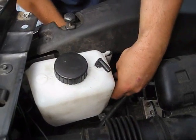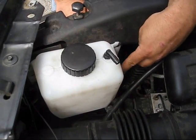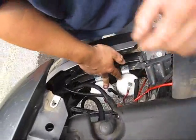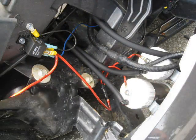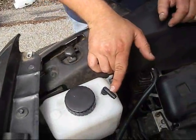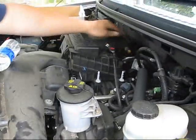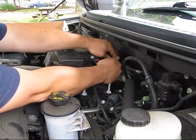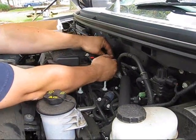You need to cut your hoses to length — the shorter they are, the better. Make sure there are no kinks in them. The hoses on the side of the tank go into the top of the units, and the fittings on the bottom of this tank will go into the bottom of these. The only connection you have to make to the engine is from this fitting here up to the intake tube. Ford's made this one easy — they've already got a port on here — but most of the time you'll have to drill a hole and put the supplied fitting in and then connect that hose.